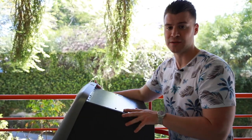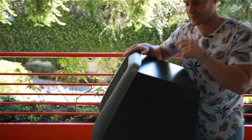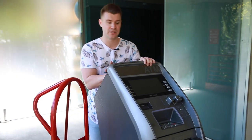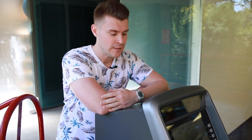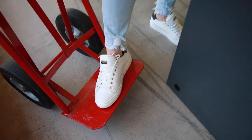A couple more tips: if you're putting the ATM in the back of your car or truck, lay a blanket down so it's easy to slide the ATM inside. Never put the ATM on its side, never put it on its front — you're going to hurt or break the screen, which is semi-expensive to fix. Always go back with the machine at about a 45-degree angle so you don't damage the machine and the parts stay inside. Put the back up against the end of your car with a blanket and slide the machine in.